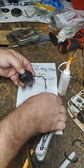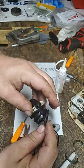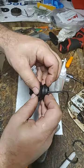Then take your new one, get some spit or some press oil, and loop that up on the inside — makes it easier. You're just gonna start that over one clip, like that, over one of these ridges, roll it over the others, and then roll it down into the groove.